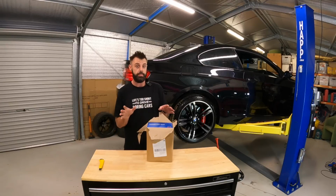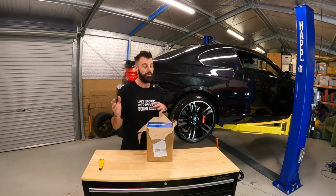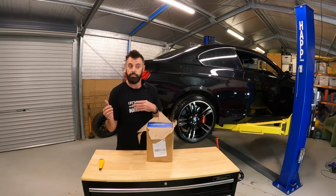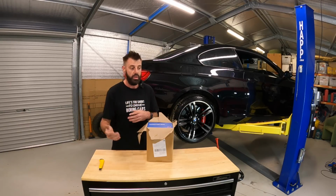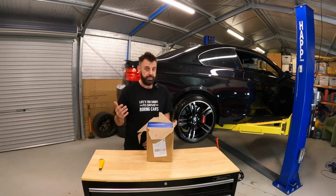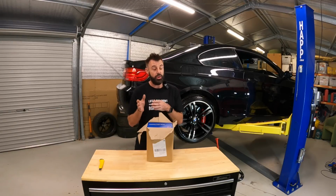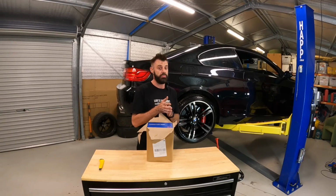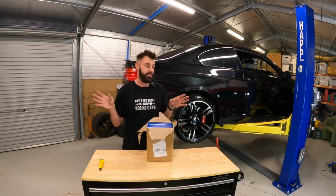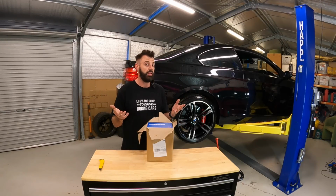My water pump wasn't getting power, so I was driving the car around. Bizarrely, the oil temp never got hot. All I can assume is that the water pump would work sometimes and not work other times. Long story short, I didn't have a water pump, and I reckon I've melted cylinder 4. The tune that I was on, although it was quick, I already had more aggressive maps to run. The motor wasn't showing anything strange in regards to knock or anything to imply that it was under stress.